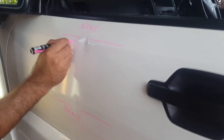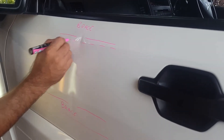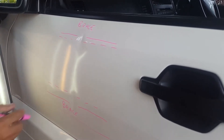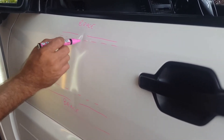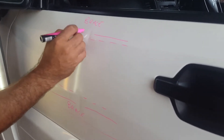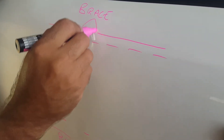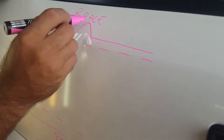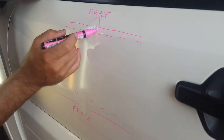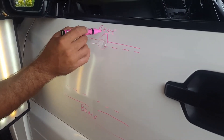The other big thing is that the dent runs through body lines — there's one there and another one down here. These body lines have to be recreated. When the metal gets hit it crowns up along the top, so all that metal along the top has to be tapped back down and let it flow into this dent, otherwise it doesn't release any pressure.